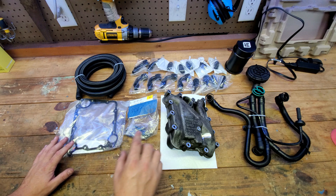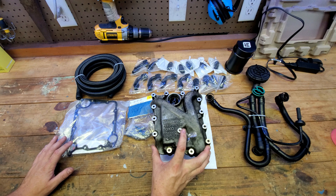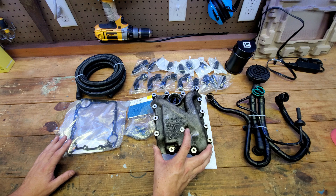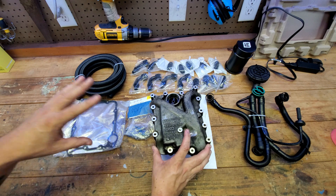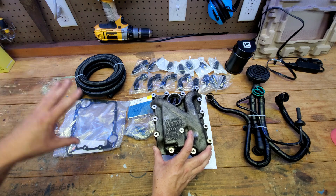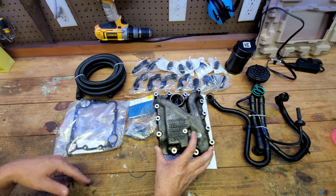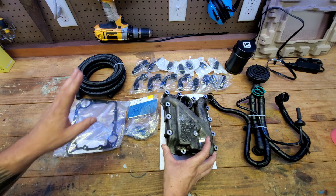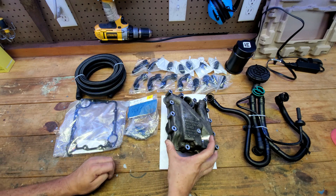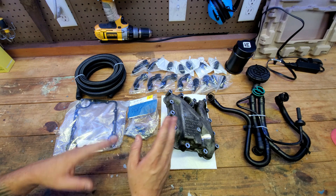The first thing you're gonna want to do is go online and find a PCV from a 2005–2006 Audi A3 of that kind of year. By the way, if you look in the description I'm gonna have part numbers to everything you're gonna need in terms of OEM replacements and things like that. I'll have a whole parts list, and might even have a link to a document that has everything detailed for this project. You need a 3.2 liter VR6 PCV system.